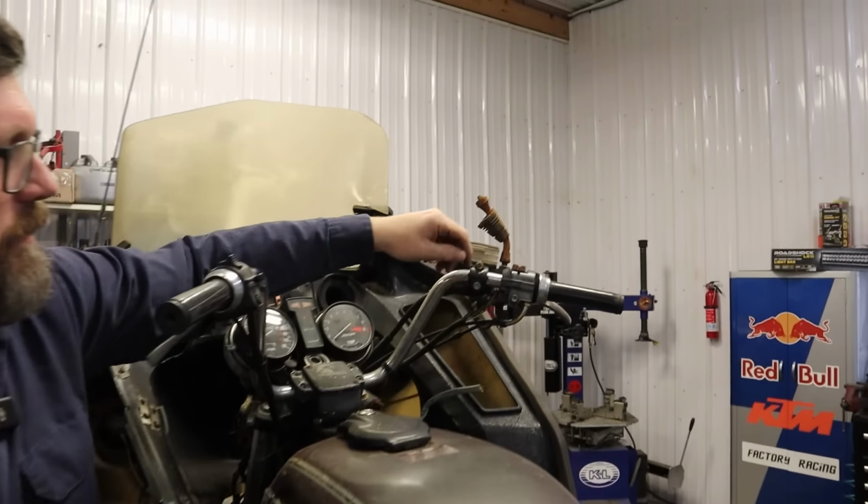Oh, yeah. That's the acetone ATF mixture that was sitting in the cylinder for the last forever. The good ATF, not the kind that's going to come after us for our hammer. True. Oh, just filthy. This cylinder is nothing but rust, pure rust. Man, bike's turning into a parts bike pretty quick, but I still want to see if I can get this motor free. I do believe we have a stuck cylinder there. Yeah, that cylinder wall is nothing but rust. Yeah, these cylinders are all part of the block. Huh, interesting, yeah. I don't think this thing is gonna move until we do some drastic measures.